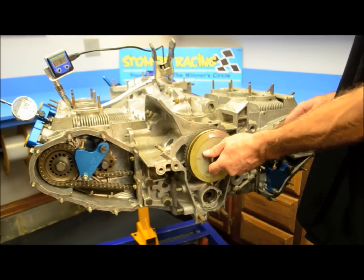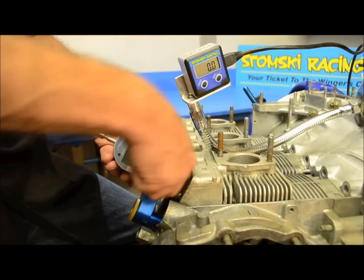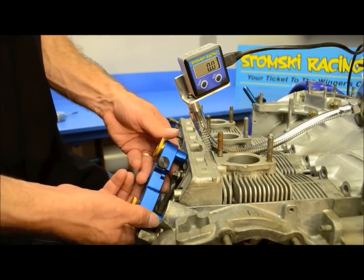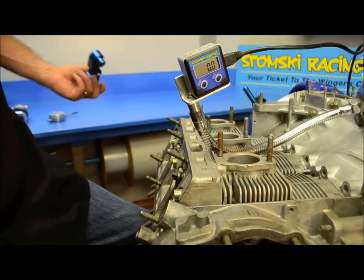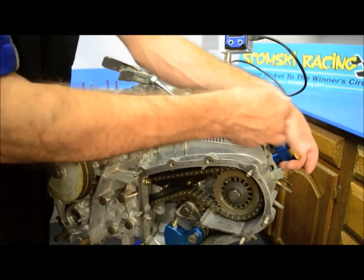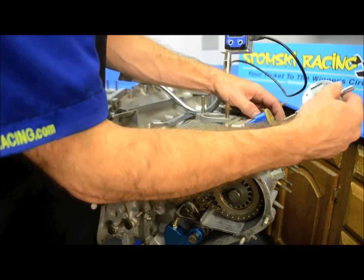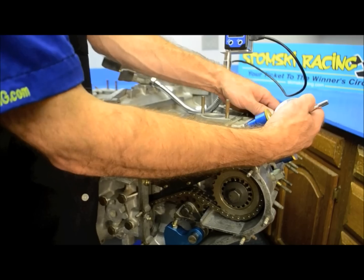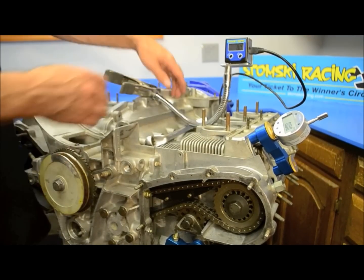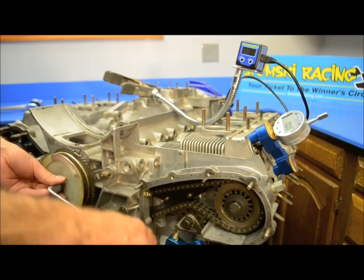Now we're going to go over and do number four and set up the right cam. Removal of the tool is pretty quick — just break the thumb screw free and remove your indicator. The two gold thumb screws spin off and you're off. Installation is the same on the right bank as it is on the left. Spin down, indicator facing me, zeroed out. Still all set on our digital degree wheel — nothing's changed on that. I'm going to start to rotate the engine around and see where we come in.